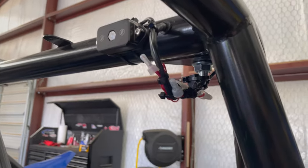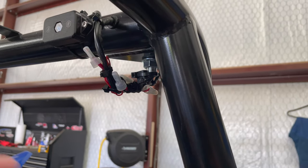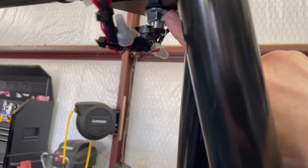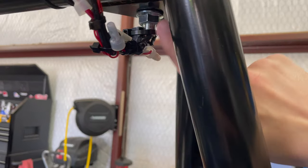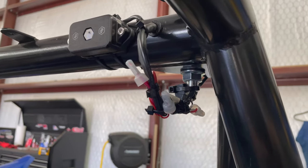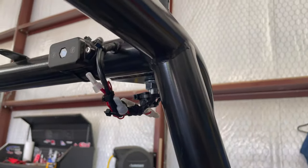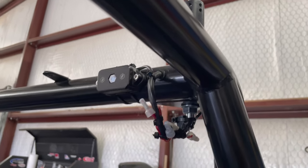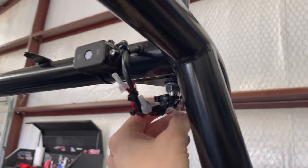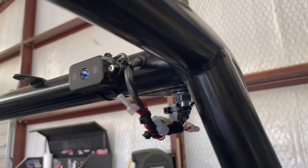One major thing to point out in terms of wire management here is that the three endpoint wires are not custom length. They're all pigtails coming out of the quick light. There is a pigtail coming out of there, there's another one coming out from up above the quick light, and there's a pigtail coming out of the Baja Designs rock light, dome light here. And those have several inches of wire on them, and I don't like just cutting off a bunch of that wire. I like to keep the wire on there because it's a finite amount. It's not like a screw down terminal, where you can adjust your wire. So that's why we have loops of slack in here.